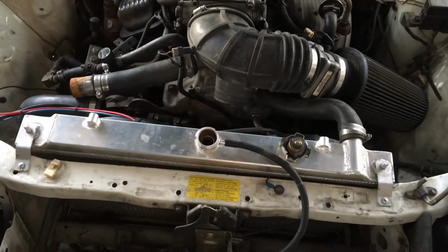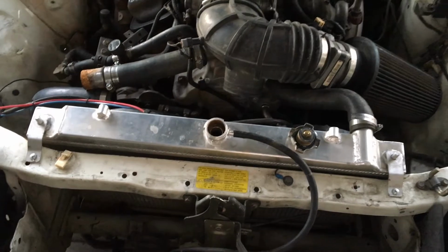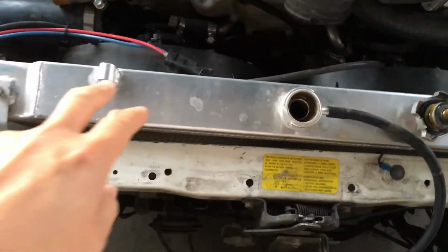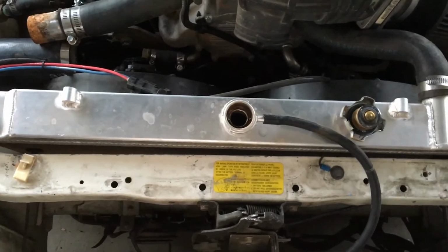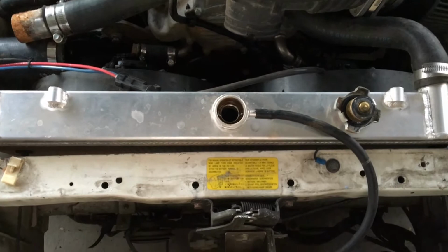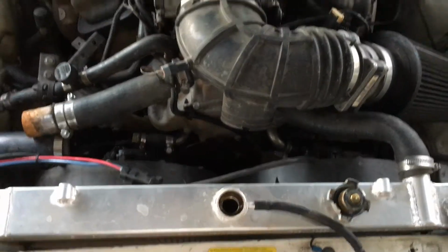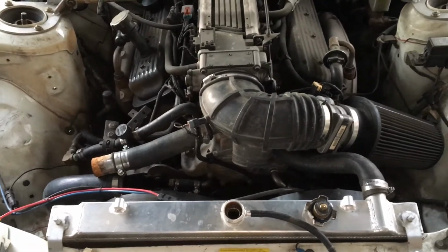Might even throw in some of the Simple Green HD, so aluminum safe, pretty much the same mixture as the Simple Green made for aircraft, because regular Simple Green will damage aluminum, unfinished aluminum. So we'll go ahead and pick up some of that, run that in there as well, flush it out yet again, and we're really giving the cooling system in this car a proper cleaning.